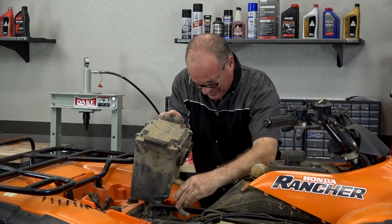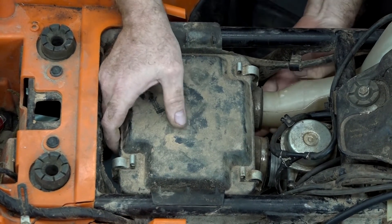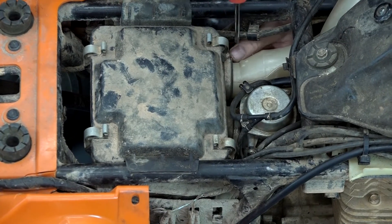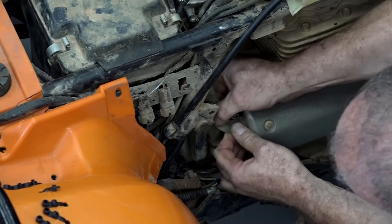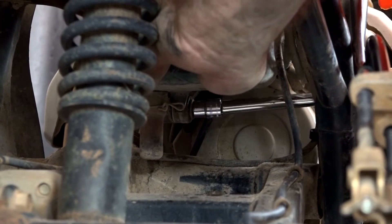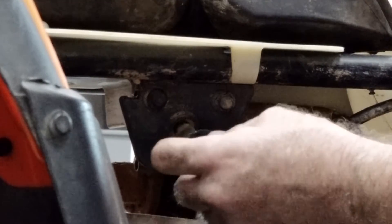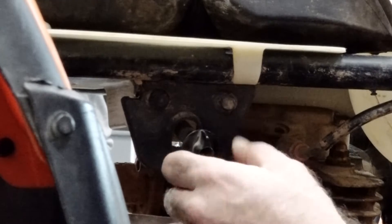Next, let's go ahead and get our intake tube in place — it basically just lays in here and there's just a single plastic rivet that goes right here. Route this little vent hose and it just sits right in there. Let's go ahead and get our air box in place, feed in our intake tube, and fish it up on the carburetor intake at pretty much the same time. Bring our clamps around where you can get to them easy from up top, then get your vent hose — don't forget your clamp. Reach around and get that one last 10 millimeter for the air box mount. Next, let's get that plug back in place of the flywheel to where you can find top dead center. Put it back on our little petcock valve extension — it's just got a Phillips up inside there. With that, go ahead and turn it on.